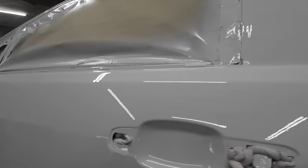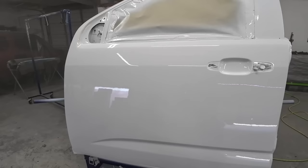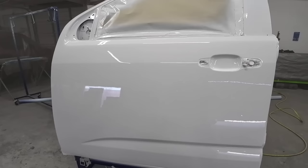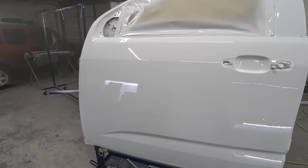Look how glassy that is — right off the gun, right after I sprayed it. I increased my pressure just a little bit, decreased my distance, and also slowed down my speed a little bit. It's all about practicing and playing with your adjustments, trying different things. Start with a baseline of 30 psi and two turns out from closed, or 2.5, then adjust your speed and distance and play around with it to see what works best for you. You can lay down a beautiful looking finish and you shouldn't have to struggle with orange peel. I appreciate each and every one of you watching — we'll see you next time on Garage Noise.